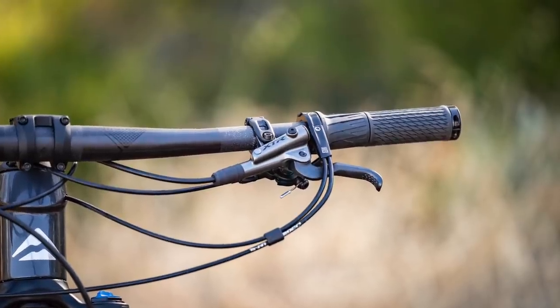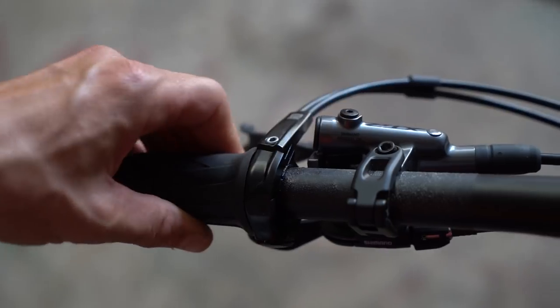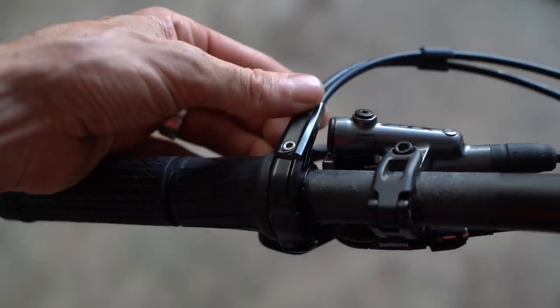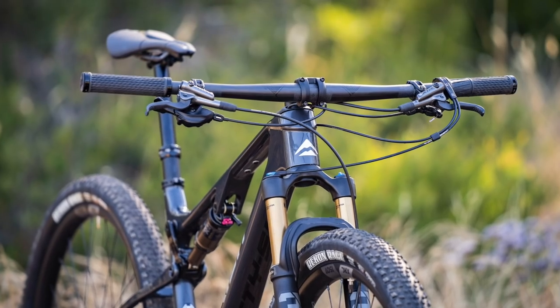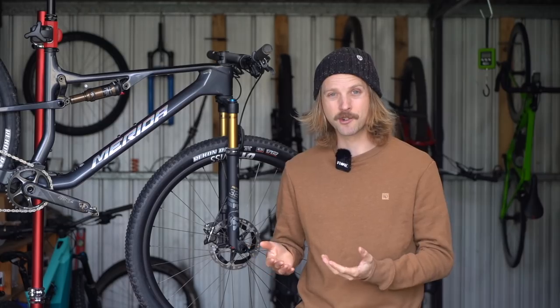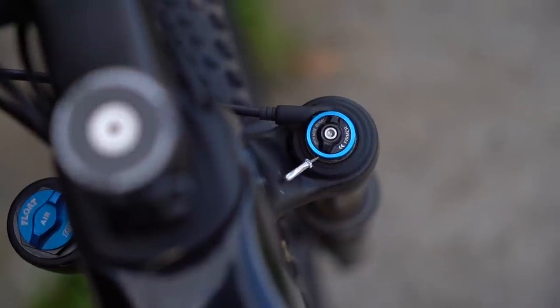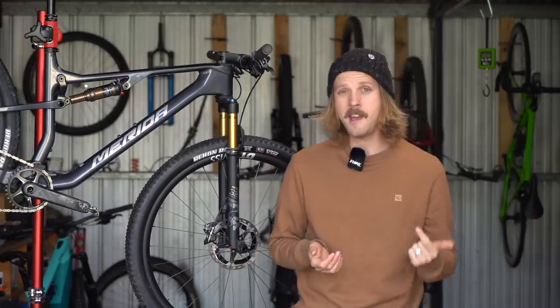As for the downsides of this bike — unfortunately the twist-lock remote was about as loose as a wizard's sleeve, rendering it entirely unusable. According to Merida, the handlebars on our test bikes are slightly undersized, and since the tolerances are quite tight on those twist-lock remotes, there was just too much play for it to stay put. Even left alone in the unlock position, it had a tendency to release the cable and automatically lock out the suspension on the trail — which was obviously no good. This possibly hints at a compatibility issue between the RockShox twist-lock and Fox's push-to-unlock damper configuration.